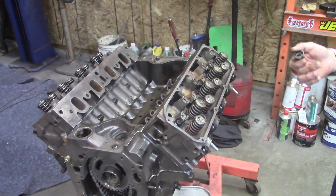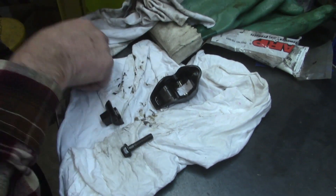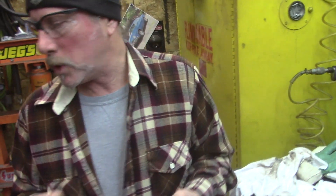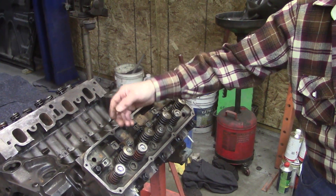We're just giving this a little bit of extra life — cleaning up all the parts and painting it. We used to call this a Ditzler rebuild, or you could call it a Krylon rebuild: getting rid of all the rust and painting it, cleaning out the insides where there was dirt and grit, wiping everything down, then re-lubricating it. We'll be priming this later — prime until the oil goes through the lifters and up the push rods and you see it gurgling out. We'll have assembly lube on everything so you don't start it up dry.